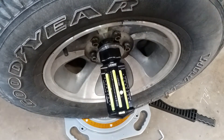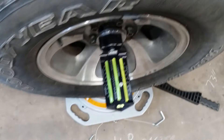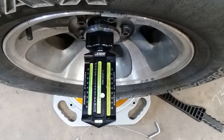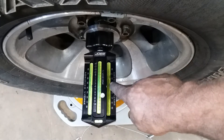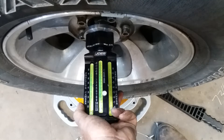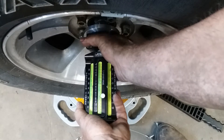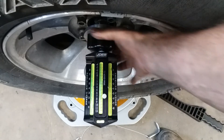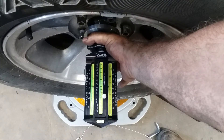This one here — we're back to about negative two on our camber. The way this works: you line this bubble up, you level the bubble, and then you read right here. We're about one and a half degrees negative camber. Negative camber is the tire tipped in at the top; positive camber is tire tipped out at the top. Wait — I didn't have it on there right. We're actually at zero camber, which is right at the factory spec. I didn't have my gauge on it right.